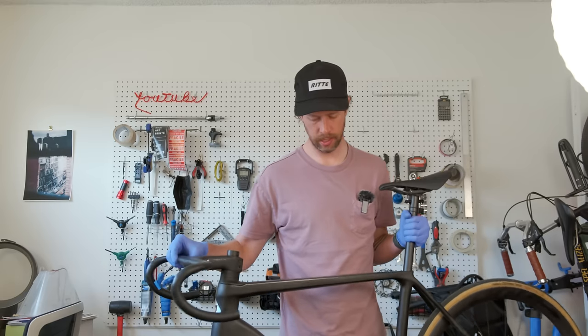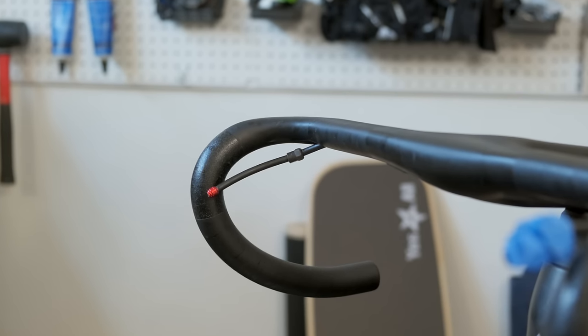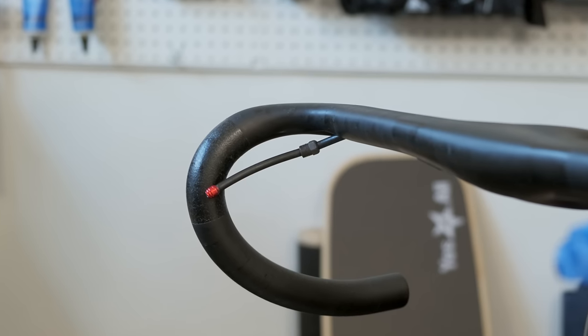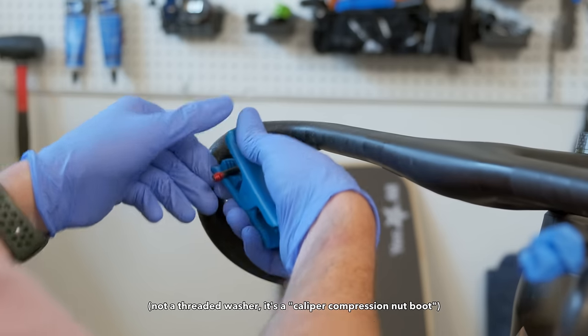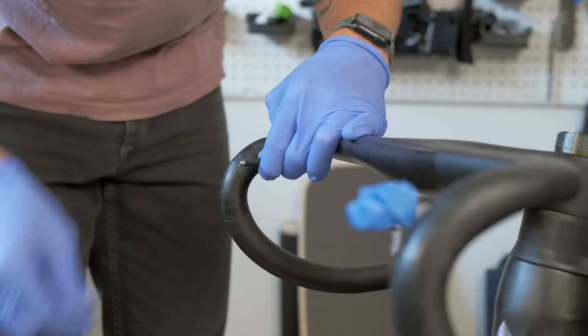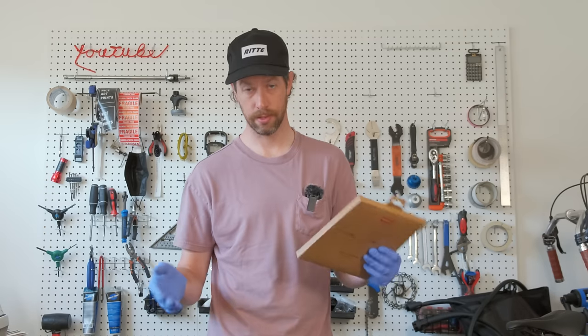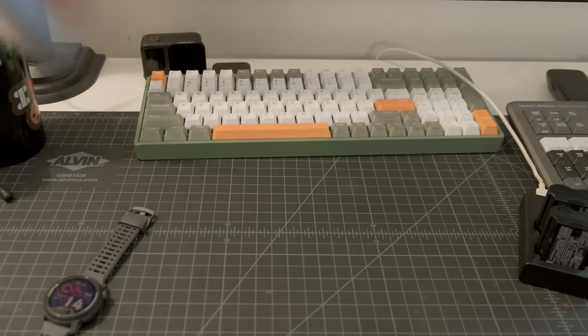The bar tape's off and the levers are off. Now comes the time where I've got to cut the hoses. You have to cut the hoses because that little red thing — no joke, this is called a stealth-a-ma-jig according to SRAM; Shimano calls them olives — that little thing and the threaded washer behind it are too large to fit through the holes in the integrated handlebar. So you have to cut off the stealth-a-ma-jig, pull off the threaded washer, and pull out the hoses. I'm going to cut them as little as possible and hope I don't need to replace them. I do have one extra hose just in case — I can swap the rear brake hose to the front and use the new hose for the rear.